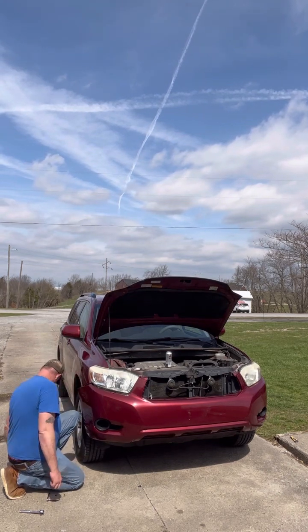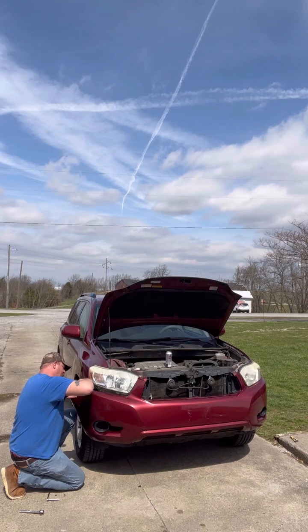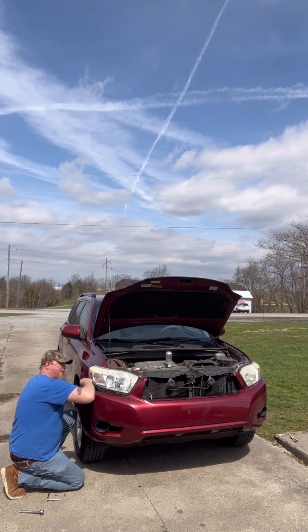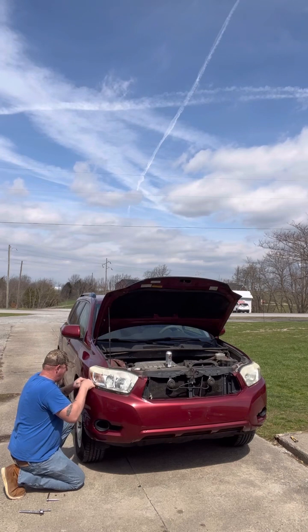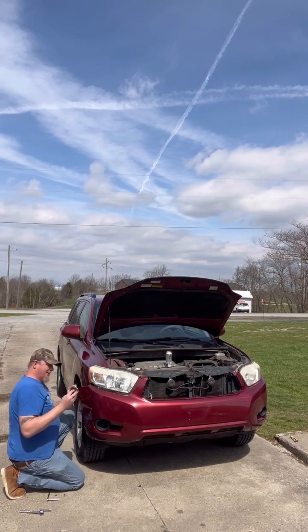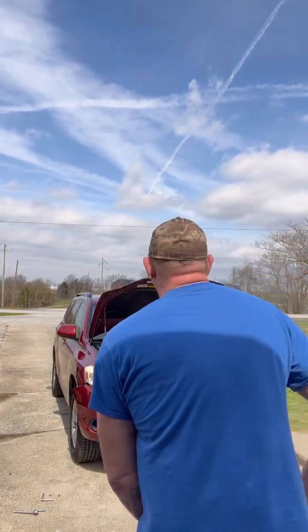Actually, I was wrong — we don't have to take it completely out. You don't even need to take the back bolt out. All you've got to do is take the silver nut and tip it — that bolt goes into the housing at the headlight. Once that is out, you don't even have to take it out of that little clip panel. There's another 10-millimeter threaded screw right in front of the fender. There's a black rubber grommet right here — you pull this off to the side; it won't break, it's rubber, and it's warm today so it's more flexible.